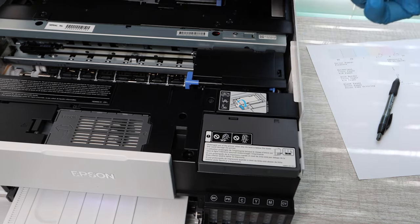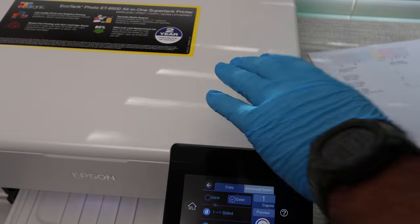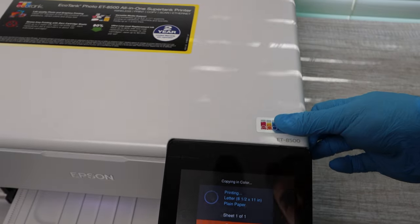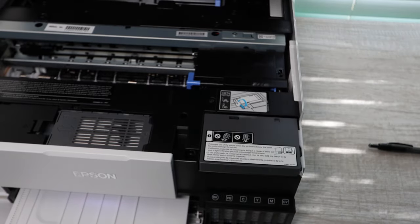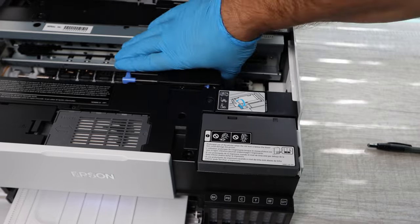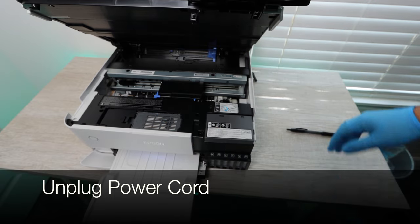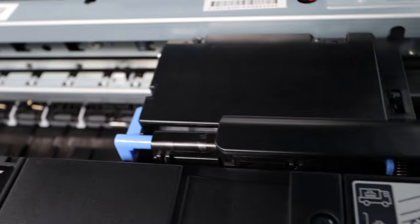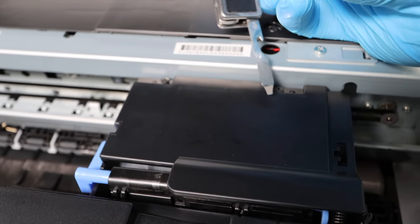In this case, I'm going to be working on yellow. If it was more than one color, you want to keep that report on the side and refer back to it whenever you're actually going to be working on the printhead. The printhead is basically the heart of the printer — that's where all the ink flows to and that's how you're able to actually print on the page. What I'm doing here is getting it to print a page so that the printhead unlocks, moves to the middle, and then I'm unplugging the power cord.